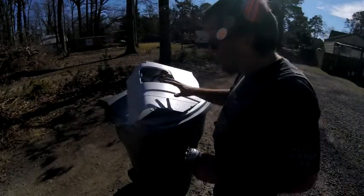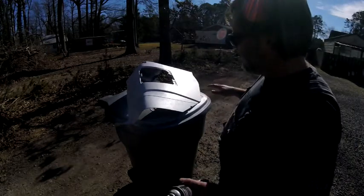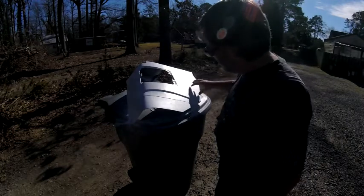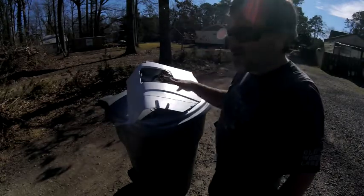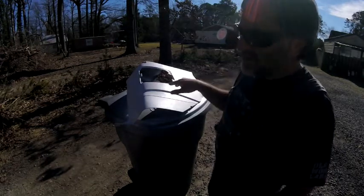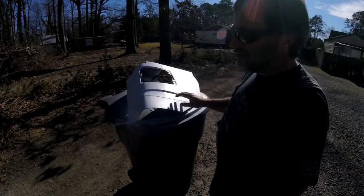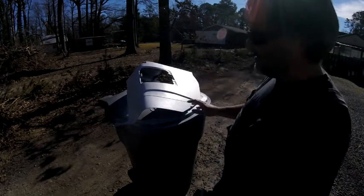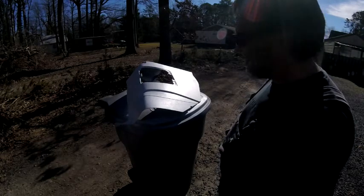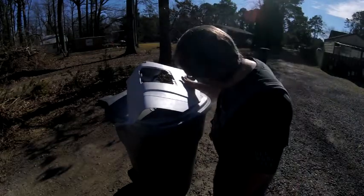So now I'm going to put one more coat on it once this wind dies down. You're going to see what I'm talking about with the gloss. You'll see the gloss come back off of it, especially while it's still wet. And that's how I'm going to know that I've got the even coats, because I'm going to paint according to the gloss, not according to the coverage, according to the light reflection. This is also how you do clear coat and stuff like that. So what you want to do is get your head in a position where you can see the light reflecting.